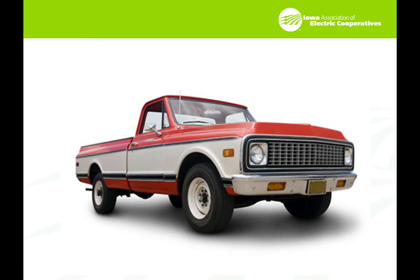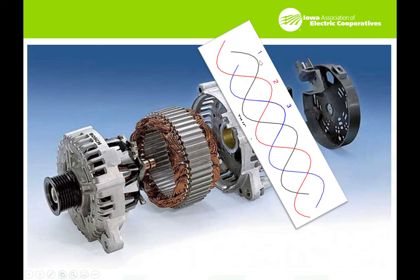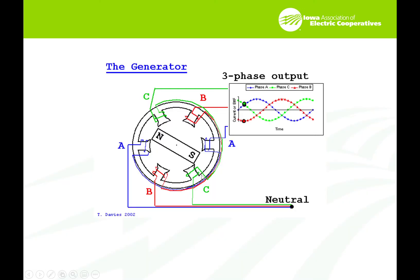Think a little bit about this three-phase. The alternator inside of a vehicle — if you look at the armature, you can see that these armatures actually overlap each other. A car alternator is actually a three-phase AC generator. It produces AC electricity and then we chop the wave off to make a pulsating DC. If we make this comparison to our three-phase sine waves, you have A phase, B phase, and C phase. Notice that these sine waves overlap, just as the sine waves do in the alternator — it looks the same.